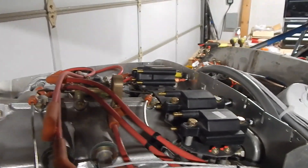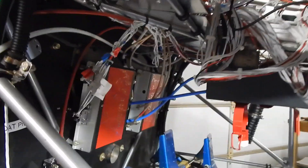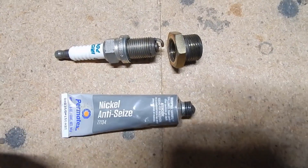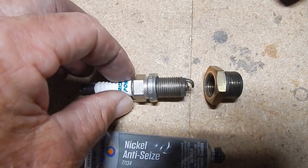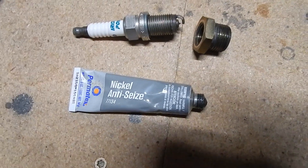With the coils all attached, I reattached the ignition boxes — that was a bear. The bolts go into the back side where there's really no room to get wrenches in, but I got it done with tiny little turns at a time. I put the harness connectors on and tied up all the wires up out of the way so your feet wouldn't catch on them. Then I put the spark plugs back in — the Titan engine comes with an adapter. According to the Lightspeed manual, the adapter goes in at 40 foot-pounds, spark plugs at 20 foot-pounds, and both threads use anti-seize.